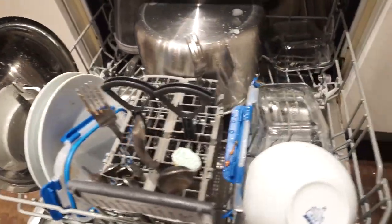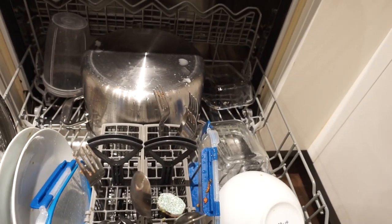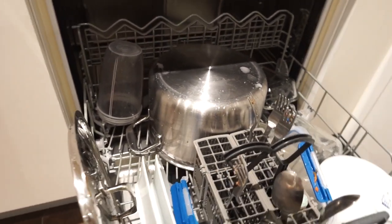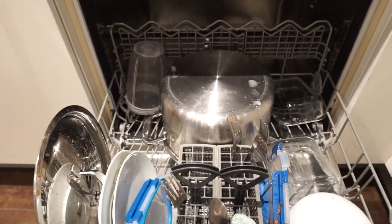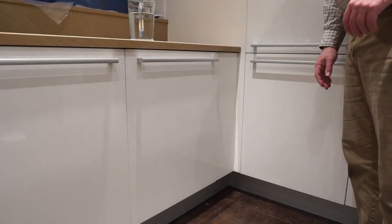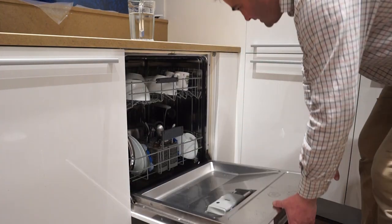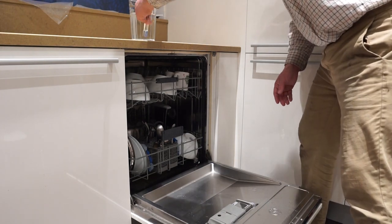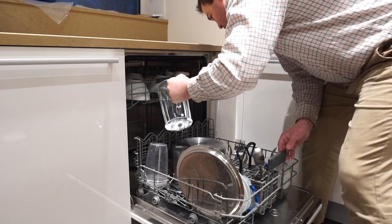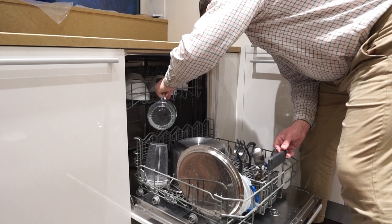It did seem obvious that the machine wasn't heating up properly. The obvious things seemed to be either the heater element, the thermostat, or possibly the control board itself. Luckily with this fault there is an easy way of diagnosing this without going too far into the machine. An easy way to check if you have a problem with the transfer hose is to open the machine part way through the wash, usually about 20 minutes in, and if it isn't steaming away, get two large jugs of water and just pour them in.